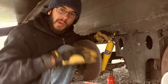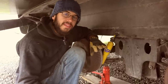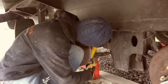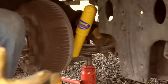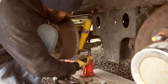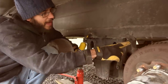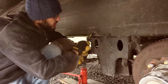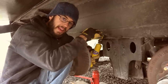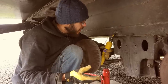Measure that distance when the trailer is perfectly neutral and level with the weight on it. If your trailer doesn't have shocks and you want to add them, it's usually pretty easy. Most trailers have an extra hole on the bottom of the plate that connects to the springs. If it doesn't, you can get kits — you take off the entire plate on the bottom and put a new one on that has a hole for the shock. Then you're going to have to weld a tab on the top to the frame or equalizer so the shock can connect at the top. These kits are readily available and I'll put a link to a couple in the description below.